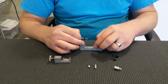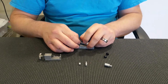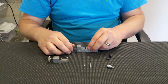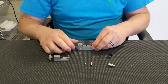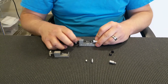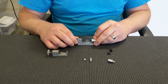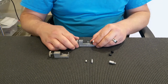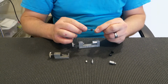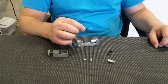Next step I'll do, since this axle assembly is going to be using our T-Boss, is I will go ahead and press it on. This hub is made for the T-Boss. I guess we could do one for you if it was special requested, but you go down, just touch it on the gear, and when you get to this point, you can take your pinion or pop it in the car, make sure that you have adequate play.